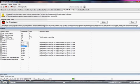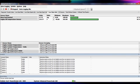The question gets to be, how do you determine if it's doing what it should be doing? Well, we could watch RPM at the same time we're doing this, but the diesels are pretty smart. We use mass fuel desired. While we're killing our injectors at the bottom, we can see this scan data at the top. This is kind of unique to this scan tool. We haven't seen many others that'll do this. But we're looking at this and we're going to be able to watch mass fuel.